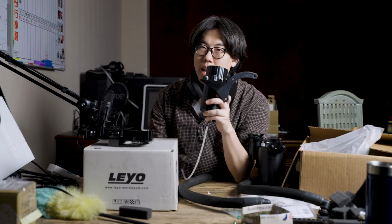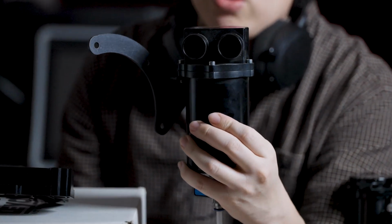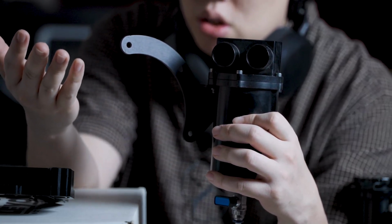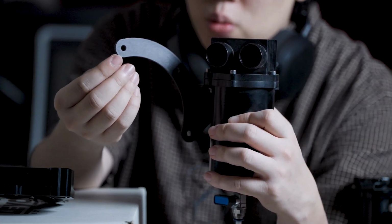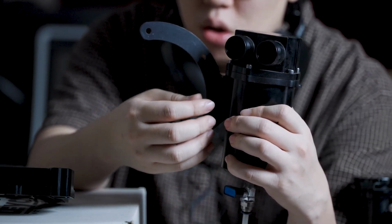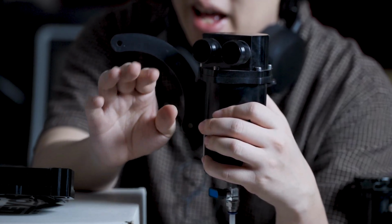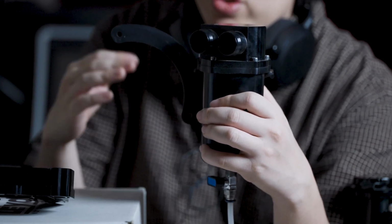As you can see, the can itself is easy. There are two holes, one for in, one for out. Hot air comes in from your cylinder head with the gas, and also with some oil. It recycles into this can and cools down, so the oil drops and no longer vaporizes. When the air goes out, it's supposed to be cleaner, and goes into your intake manifold again. So you recycle it.